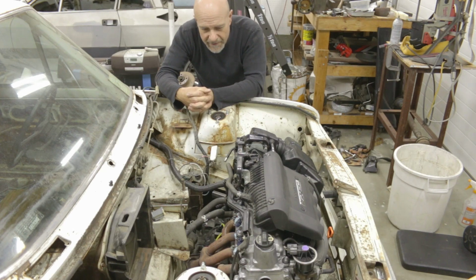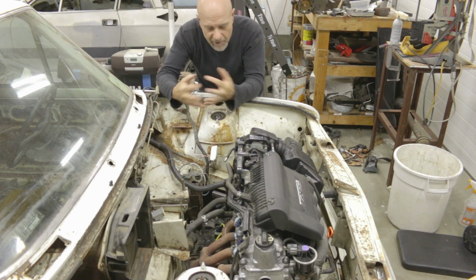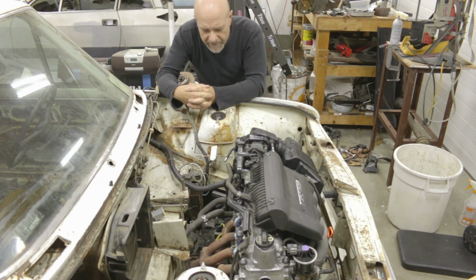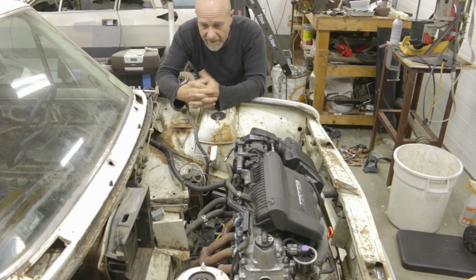I mean, it's not ideal to tilt an engine in its configuration, but it's not going to be a radical shifting of like 20 degrees or anything like that. So the oil pickups in the oil pan should be fine and able to cope with that, no problem. The lubrication system shouldn't have an issue with anything. I really can't foresee anything that this would cause an issue for. I mean, cars are made to be driven up inclines, like going up a mountain pass for 15, 20 minutes, and still operating very well within incline parameters.